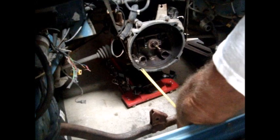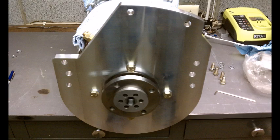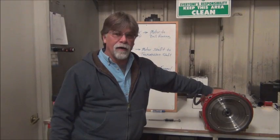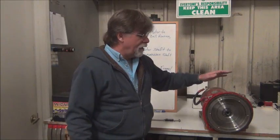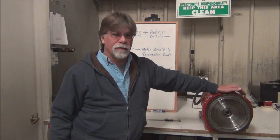What I'm going to do next is show you some slides of some different motor mounting setups, just to give you some ideas. One thing about the classic VWs and some of the real early Porsches is that they don't use motor mounts on the engine — the motor mounts are only on the transaxle, and you bolt this directly to the transaxle with no additional accommodation necessary. So they're easier to do in that regard — you don't have to create some kind of mounting setup.